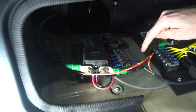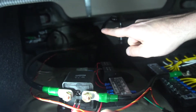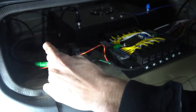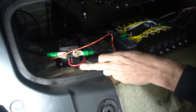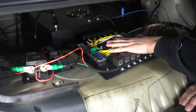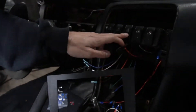This is our 200 amp relay. One wire runs around and goes straight to the positive terminal on the battery — not hooked up right now but that's where it's going — and that runs up to the ignition switch on the column. From there, the first click runs back and gives 12 volts to this side, which powers this relay. This side is connected to the battery with a 3-gauge wire, comes through the relay once activated from the key, and runs to the positive side of the relay board — that's the first click on the ignition switch.